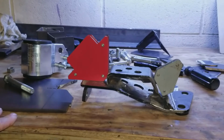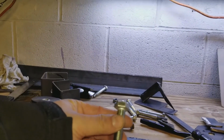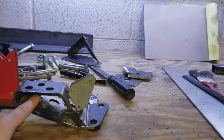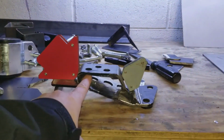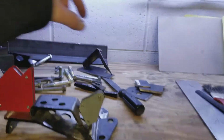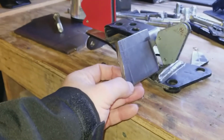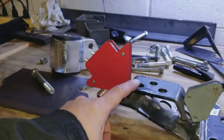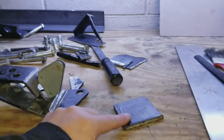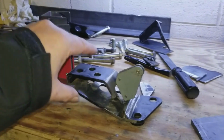Of course, I went to the hardware store, and oh my God, hardware is so expensive. It's unbelievable. I got all the bolts and things that I need, but I didn't get any M12 by 1.25 nuts, so I can't have Kenny weld nuts on the back of there until I do. Once I get these nuts welded on, I can go ahead and weld this into position, and I've got another plate I'm making. This 1/4-inch plate will go on this side, as you can see how that's going to shape up. Once I get the three nuts captured, get that on, tack this into place, trim this up, make sure it fits correctly, tack it with my super awesome welding skills, take it over and have Kenny weld it, and then this mount will be done.